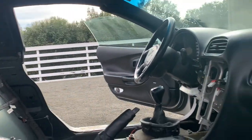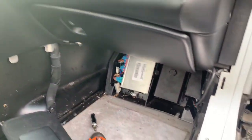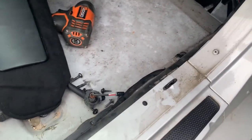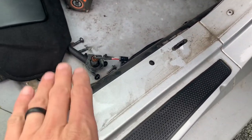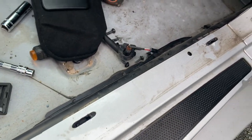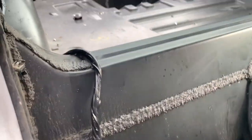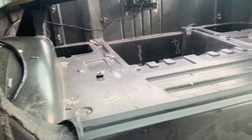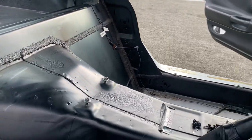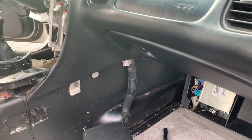I think that's about it for now. I'm going to keep on trucking, pull out the dash, and start to get rid of some of the things that are under there, so I'll tune back in to talk about what I'm doing there. Now is also a good time to go ahead and check your outside frame rails. One of my parts cars that I picked up at one point - I found when I took off the plastic that there was actually damage to the side rail from a side impact that had been covered up by a new rocker. In this particular case, everything's looking good. I've just gone around the car, inspected all the SMC in the back to make sure there aren't any cracks - all that looks good and I didn't find any evidence of leaks. So the car looks to be pretty solid.